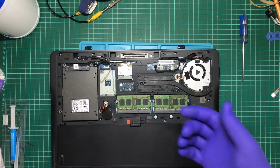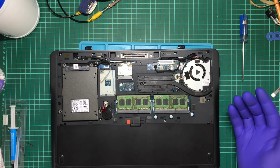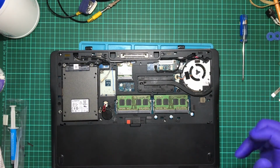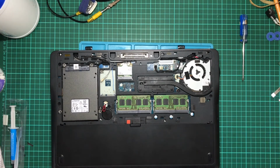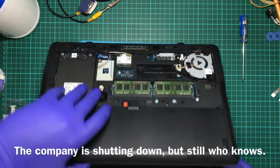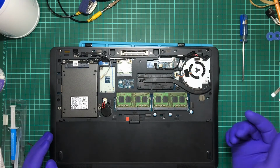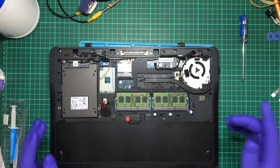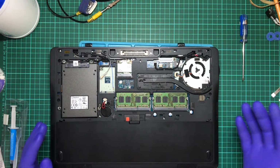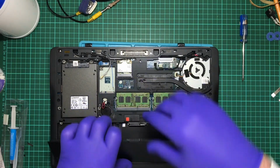Okay, so I kind of screwed up and I showed a part that I didn't want to. It's just the top of the laptop. It's got something special on it. It identifies it, so I don't want particular individuals getting into trouble, although the system's still on, as you can see. And before, which I didn't show, the fan was spinning at this point. So my hope is that the thermal paste I put on here is going to help keep it cooler, which is exactly what I want. And now I can just simply remove the battery.